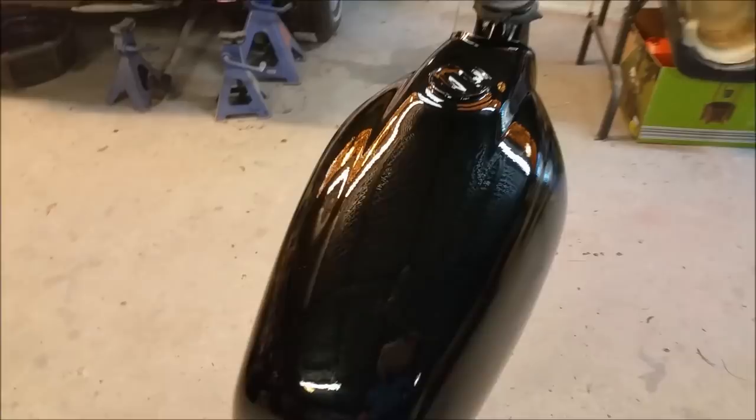You can see there's overspray underneath it. So I might paint underneath it silver. I might mask off the top and paint underneath it silver. But that's looking pretty good. You know, it's off the gun. It'll dry a little bit duller. Acrylic paint gets its sheen mechanically. So your wet sand and buff, that would buff out to be mirror. Absolutely mirror.